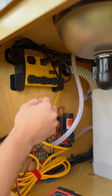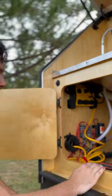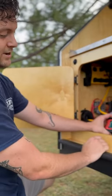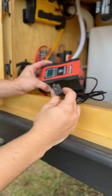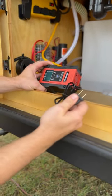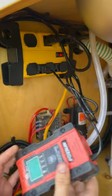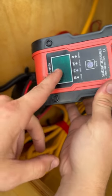We have two plugs on the interior of your camper — those are your 120 volt plugs, which are your house-style plugs. The last thing back here is your battery charger, which plugs into the yellow power strip. As long as you have your battery installed and your master switch on, plug this in to any outlet and it'll automatically come on and start charging your battery.